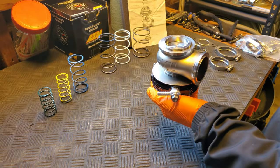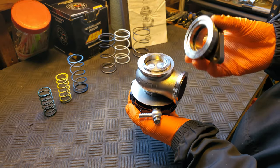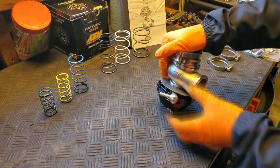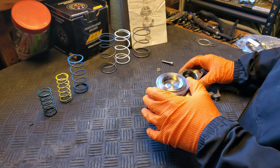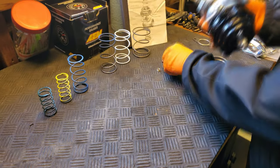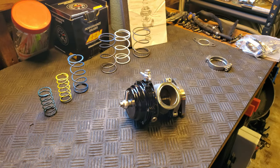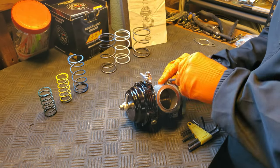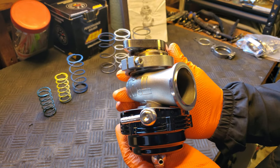The Tial wastegate has a V-band style flange on both sides, so if you decide like us to use a Rev9 exhaust manifold, you'll need to get a 2-bolt to V-band adapter flange. And when getting this flange, something to keep in mind is that when we originally got ours, we had an issue with the adapter not seating the wastegate valve closed when we tried to install it. We can't say it for certain, unfortunately, which adapter will work, because in our case, we had the mobile fabricator mix up some of the parts we had laying around to fabricate a properly working one.